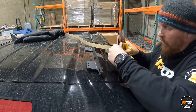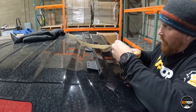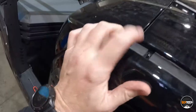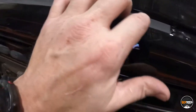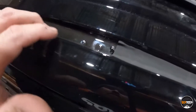Using this foam seal allows you to put the spine brace on without using silicone. You'll still have to seal the rivet heads when you're done, but it keeps it from making a huge mess in this track. We've got the foam applied at each location over where we drilled. You'll see where we skipped over the rivets — there's a gap in the middle where there are no holes, so there's no reason to apply foam tape in that section.